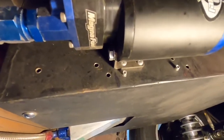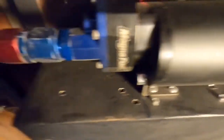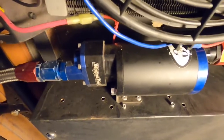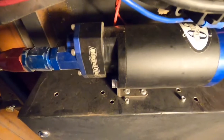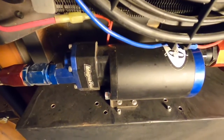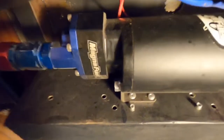Going down the list — see how I have where my fuel pump is located. The fuel pump I run here is a Magna Fuel 750 inline pump. This pump is good to around a thousand horsepower on E85. They have come out with newer pumps since then — twin motor brushless — Aeromotive makes one, and Holley that can support close to 1500 — but this pump is more than adequate for what I'm doing right now. This car makes around 850 wheel, so this thing is perfectly capable. It's a good pump, and I want to say I paid around $450 for it.